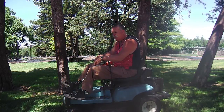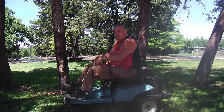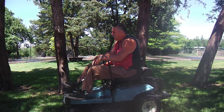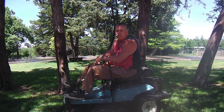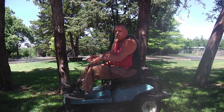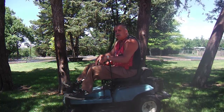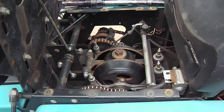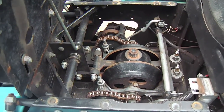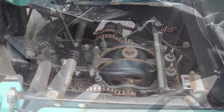Dixon, it's the friction drive, and for people out there who are familiar, there's really nothing like them. They stopped producing them about 10 or 12 years ago, and I think they're worth having, especially if you're kind of cheap, you can pick these up cheap, because people will run them after a few years and not know how to keep them in adjustment too well, and they'll just leave them sitting in their yards. And here I'll show you the friction drive transaxle, the cones. Now they're pretty much obsolete and made so by the hydraulic units.